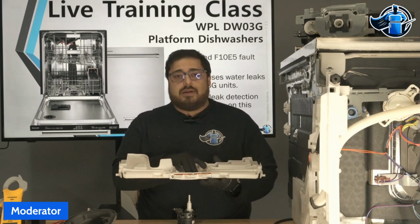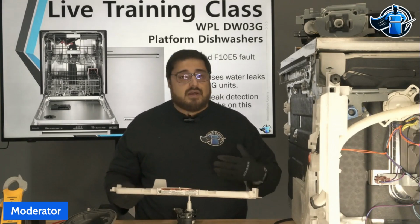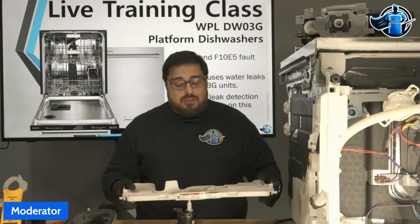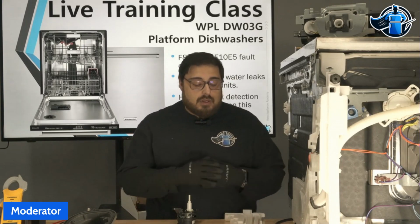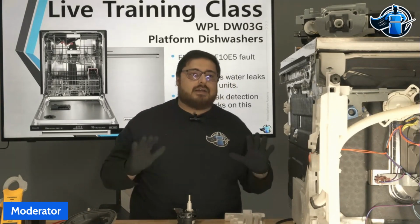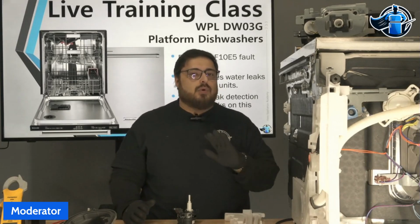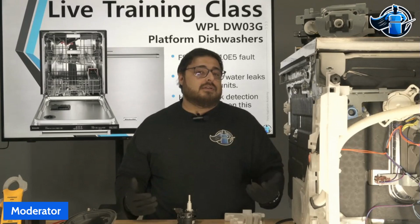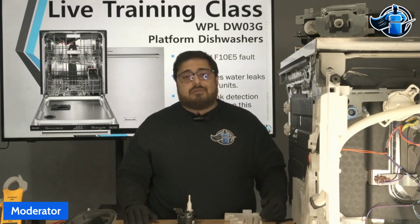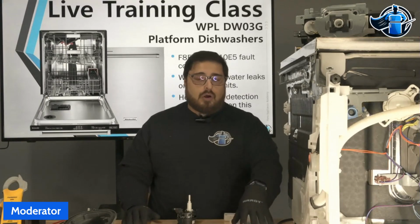Once you have water in this tray, there's a reason for it. I've seen several techs. I've done it myself. I go out, I run the unit. I got an F8E4. I got physical water in the tray. I run the unit, no leak. At that point, it's really easy for a technician to say, it's just not leveled correctly. Let me level it. I can promise you leveling on these units will never cause a leak. I've had this unit all sorts of wonky to try to get it to leak. As far as leveling goes, leveling doesn't do it. There are particular things that have to fail in a specific order where you get water into the tray.